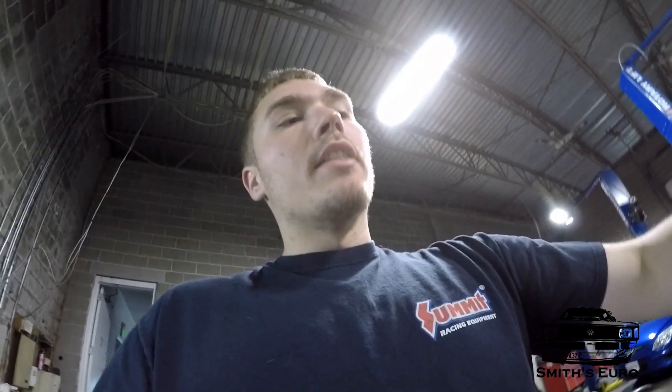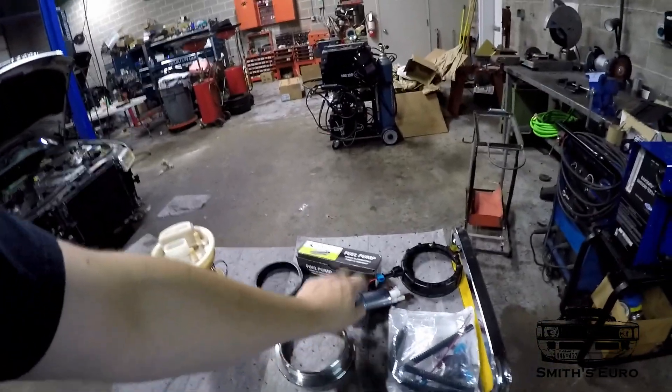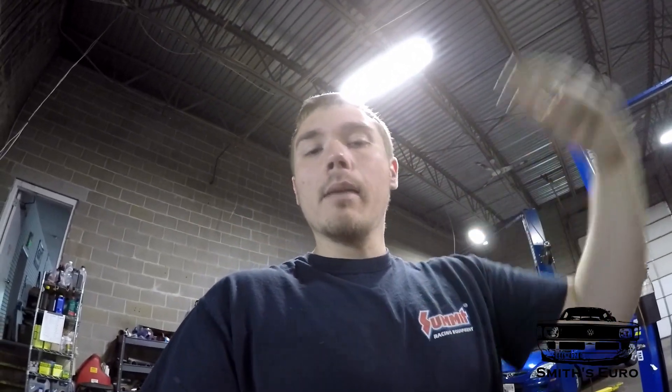Just make sure you get the OEM pump unit. I'm going to show you how to take this apart, and then what we're going to be fitting is a TI Automotive Walbro — whatever you want to call it. This is a genuine Hellcat pump, good for about 900 horsepower naturally aspirated and around 700 forced induction. Power goals for the Rabbit are about 500 to 600 horsepower on pump gas. It's E85 compatible too — on E85 it's good to about 500 horsepower. Bigger versions exist but they don't have check valves, which keep pressure in your lines after you turn the car off.